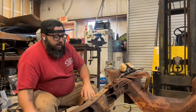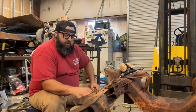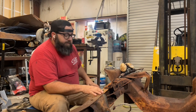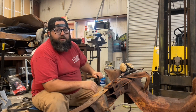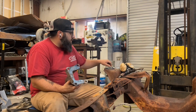Move on to wire-wheeling the frame — get it cleaned up pretty good, get as much of the rust and dirt off of there as you can. Then you want to coat your frame rail underneath where your cab's going with the same rust preventative stuff as you put on your cab mount. We're not going to do that with ours right now because we're going to be using this chassis for another install video coming up.